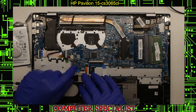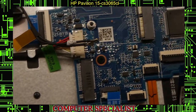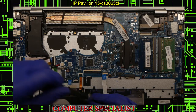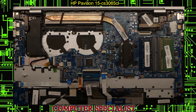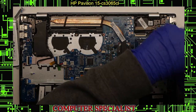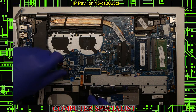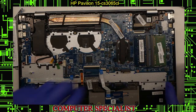We'll start taking out the motherboard screws. Luckily, all of these are labeled with little tiny white triangle arrows, which tells you that a screw belongs there. So if you're putting it back together and you see one with no screw in it, you know you need to put a screw there. We have one, two, three screws, and another one down here which is a different silver screw. There's another silver screw up here, and another one up here as well. Check underneath the memory — nothing there. That is it for the motherboard screws.